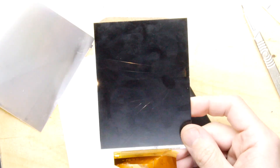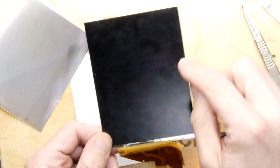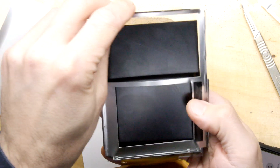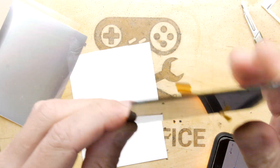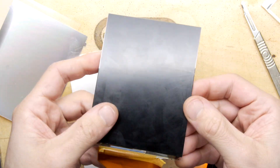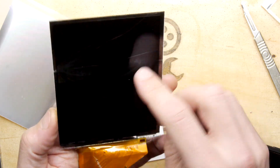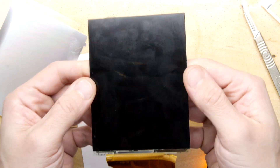I'll describe it to you: the screen itself has the top TFT and there's a black bezel, and then underneath I can actually see the bottom screen — it literally is that inner portion. The rest around it is black even in this glass substrate. So these really aren't entirely regular TFT screens — they're manufactured that way because it's easier — but the matrix itself is definitely treated as two separate regions.